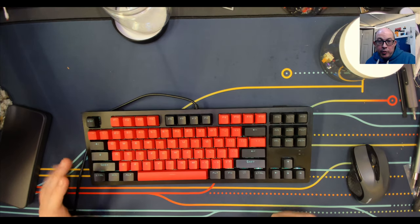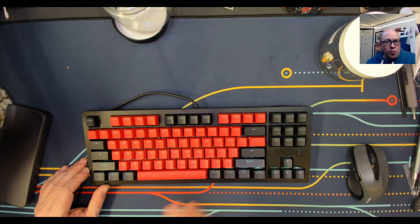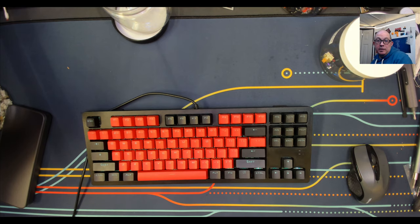So here we are with my modded Eyooso K620. I was aiming for a little bit more clack because people are either going to like something that's silent or something that's clicky, and I felt that the sponge being a pretty snappy tactile, because of the dual stage spring and the cheaper caps, would lend better to a clack. Akko switches for the most part, especially with clear tops, just tend to be more clacky. Not that that's a bad thing, that's just what I found.